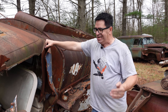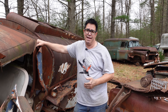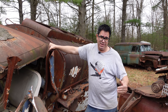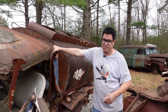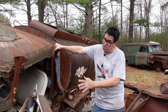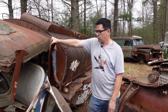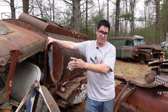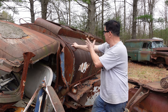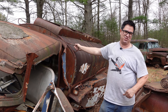Torsion bar front suspension on 9,000-pound GVW trucks. These trucks were available in C10 through C40 as the Apache, C50 through C60 as the Viking, and C70 and C80 were called Spartans. This one being a C60 would have been a Viking. It could have been had with a 409 or a 348, but this one has the basic 261-cubic-inch Stove Bolt 6. So 1962 — final year for torsion bars, final year for the 261. But something cool about this one is the oil delivery body. Check out the next video for that.